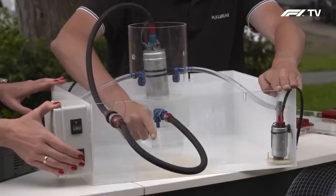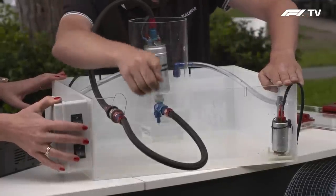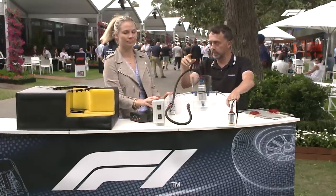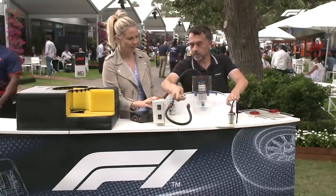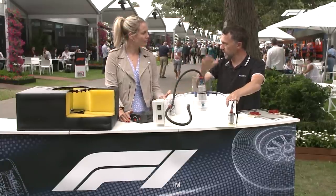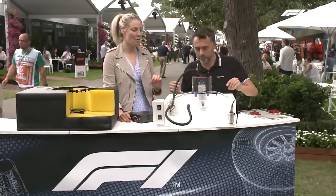We see that this pump is pumping the fuel, which goes through the engine and it is back to the fuel tank. In this place, there should be a third pump. This one is the same for everyone — all the teams are using the same fuel pump. This pump is electric, as you can see from the connections. But there is also a fuel pump that is mechanical, and it pumps the fuel up to 500 bars, which is the maximum that the regulations allow. Same pump for everyone, even the pipes are the same — they don't want any tricks on the fuel system, as we know from the past.